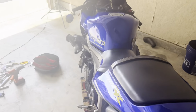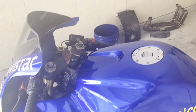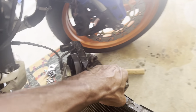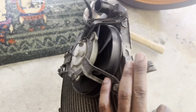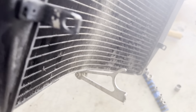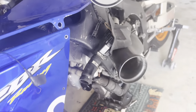Most of y'all have probably already seen the bike, but if you're new to the channel, that's for you to see. First things first, I had to take the radiator off. It was sitting up behind the front wheel. The fan is on the left side of the bike — you take these two screws out, unplug your thermostat wire for your fan, and pull the stay bracket from around the exhaust. Then obviously take off the upper and lower radiator hoses on this side — right here, here, and here — and then your upper on the other side.